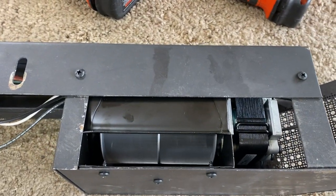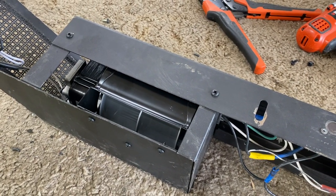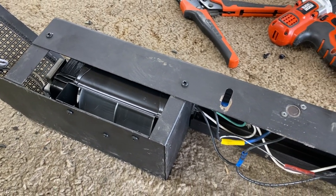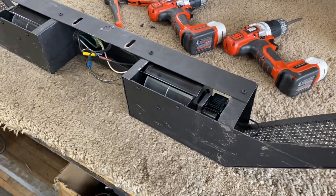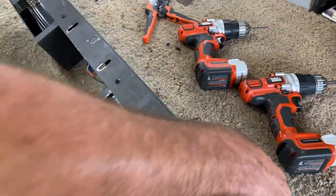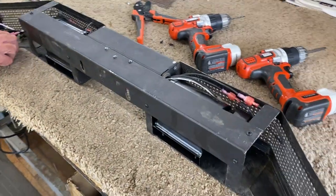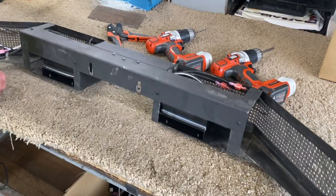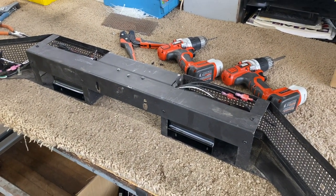Another thing: you'll see that these guys are perfectly balanced. The wheels are slightly re-pitched, so we're getting a little additional airflow. The motors are more efficient than the original ones, so they're not going to draw quite as much current. We do that without sacrificing airflow — so those are a couple of additional nice features about these motors.